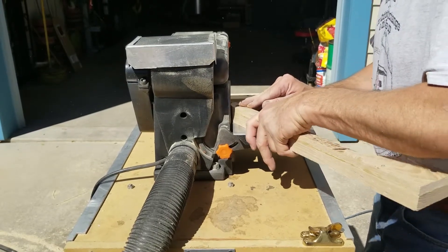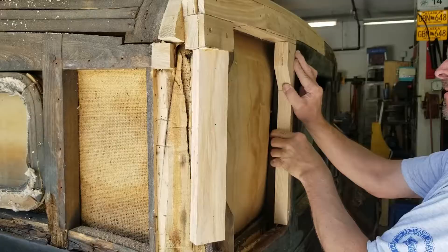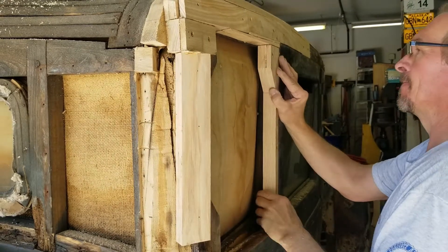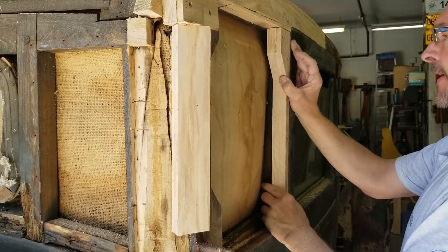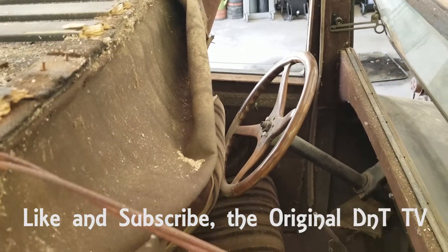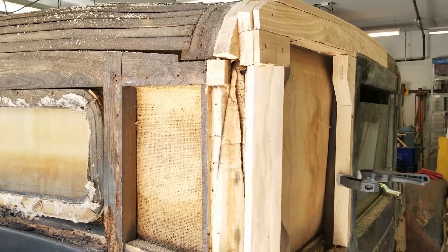Back forming that vertical again so that it's actually going to fit beautifully. Remember throughout this we're trying to keep as much of the original Kissel wood as possible because the car is so solid except for these little damaged areas. Everything is being measured and set, trying to make the car even side to side, even though in some cases the original Kissel wood was not even. Remember, it was a hand-built car — beautiful when they were done, but very hand-built.